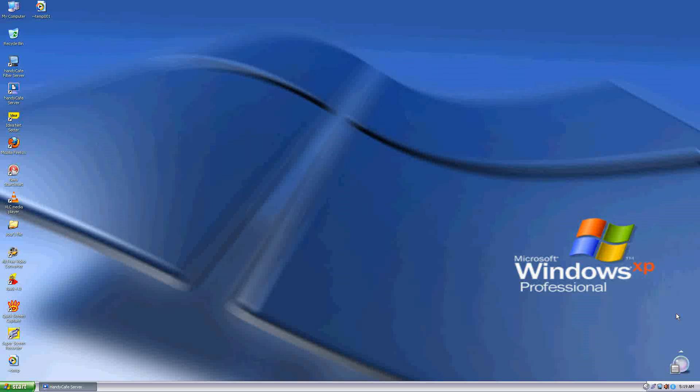So let's start with Windows XP. I have Windows XP installed on each of my workstations as well as on the server. First of all, you need to connect all the hardware — the power cable and data cable of the printer — to the server. Second, turn the printer power on. After that, install the driver CD which comes with the printer.